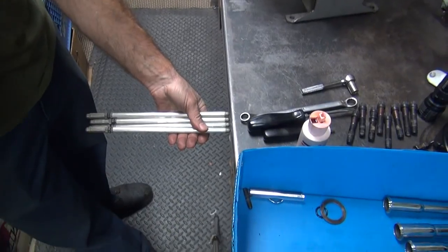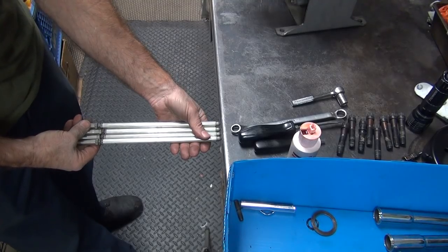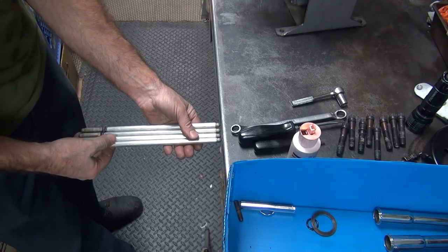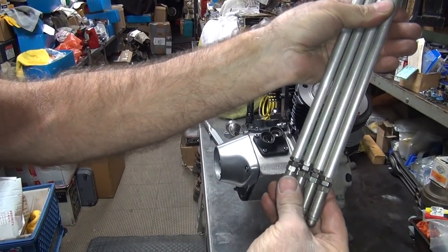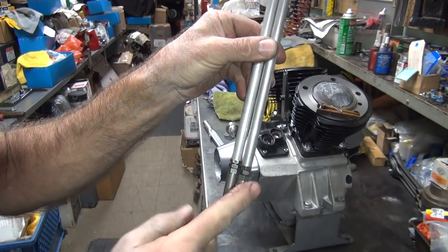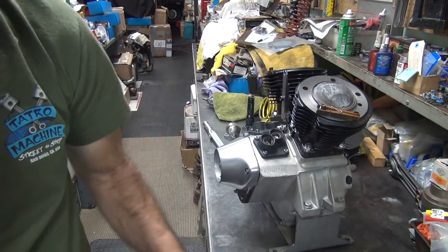Okay, I want to check my push rod length, so I got a push rod checking tool — it's called a workbench. Looks like we've got about three different lengths — basically four, almost three is what we're supposed to have. You look at the adjuster down here at the bottom: these two here are equal, those are the intakes. We got one short one and one long one — the long one is the front exhaust, the other is the rear exhaust. So lay them out on the bench like they go.